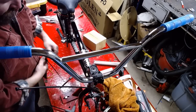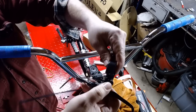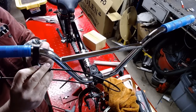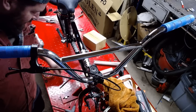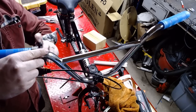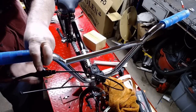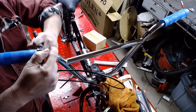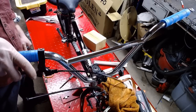Alright, we got the cable all hooked up. So we are going to route the brake line around the front here and loop this over the bar. On the back side here, this is the hinge and the bolt — I have the bolt here in my hand. I will thread that in there from the back side once we get it over the bar. Make sure you do not get this cross threaded, so just start it in there with your fingers, real gentle. Take a 5mm Allen wrench and kind of run around in there. Get your brake lever at whatever angle you choose to have it at, then tighten her up. You don't have to kill it, just snug it up. Doesn't go anywhere. Check the brake levers — everything is sitting pretty good.